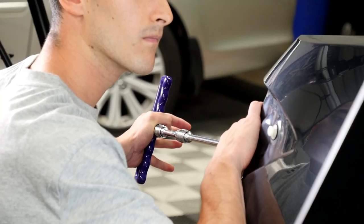I'll do a picture-in-picture on here for you too. What he wants to do is gather some metal. Watch his pushes — he's going to have a lot of control with his pushes. A soft tip in many incidents is that you think you can push the whole dent out with it, and that's a lot of people's mistakes — to use a soft tip for the whole time, especially on deeper dents. This dent isn't quite deep, it's just a little more stretched than what it appears. Jordan has good control with his hands.